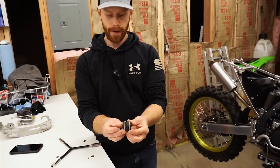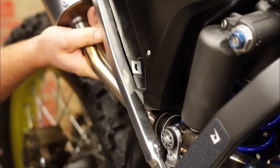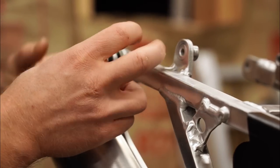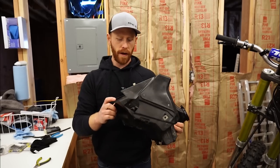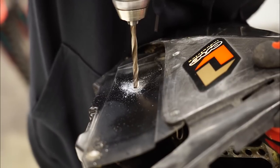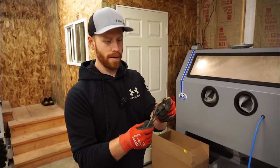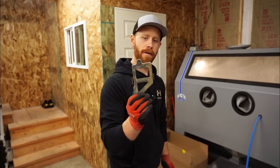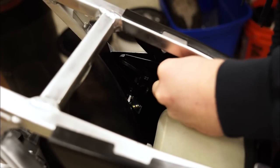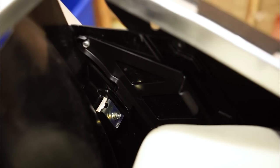I was missing the little rubber boot that connects the pipe and silencer — let's get that on. Going to swap out these standard looking washers for some drilled ones. You guys might remember I was looking for a CDI box mount — I found one, but I had to buy the whole air box with it. So I'm going to pop this one off. This thing is crusty as heck — there's no way I can bolt that on the bike like that. So let's blast it and lay down some cerakote on it. Let's go ahead and get this CDI box riveted in place. That is all dialed in now — love the black on black.